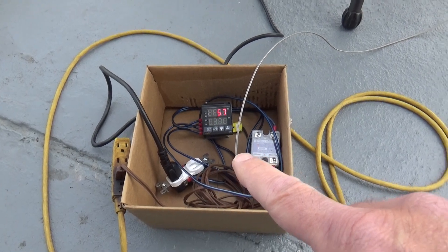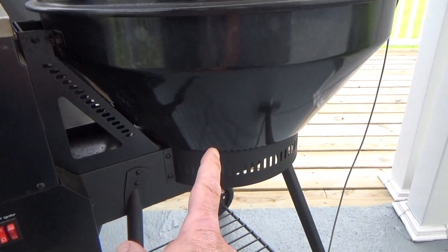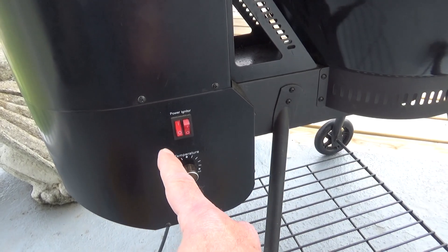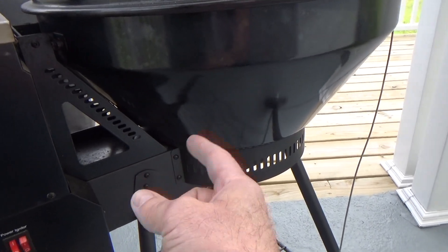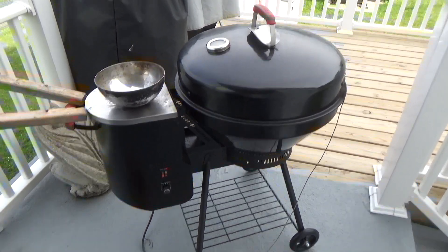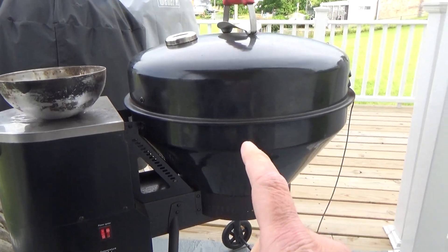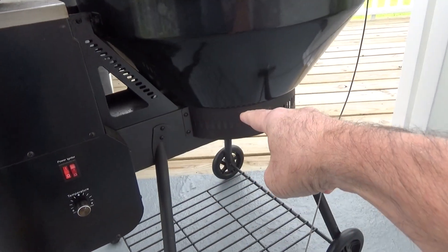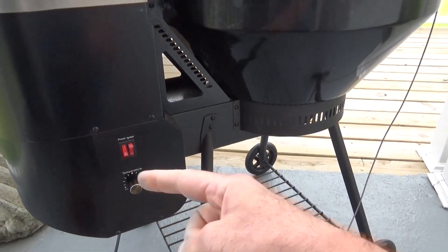The thing I wanted to mention about this setup is that when the PID goes off, it shuts off the auger and it shuts off the fan. That's the danger of this setup I have right here. On the new ones, the fan continuously fuels the fire in the fire pot and it's just controlling the auger. My other concern is if I have the auger speed up too high, will it put too many pellets in the fire pot and snuff out the fire, because that fan isn't continuously blowing?